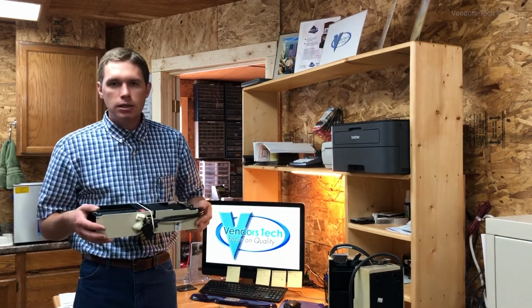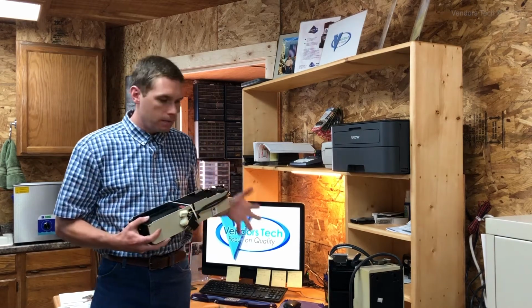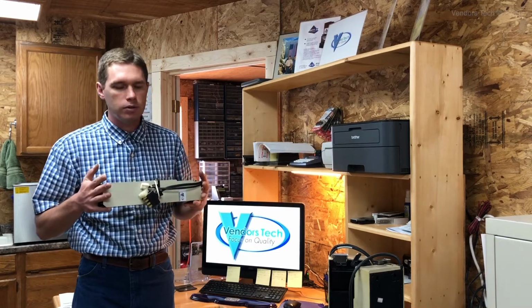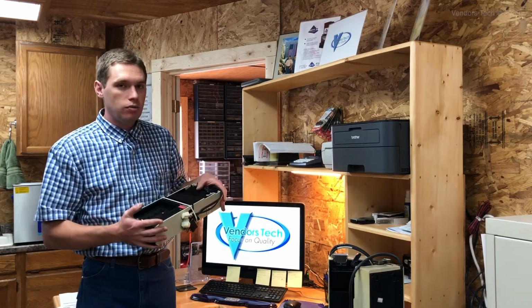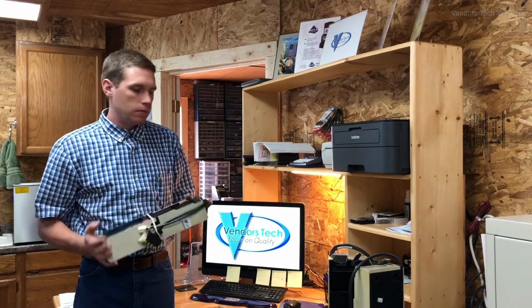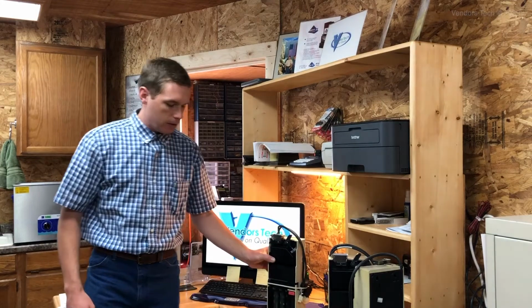When we package these, we're very careful. You've got to have padding here and padding here, because these things are incredibly fragile. All coin mechs are incredibly fragile. You've got magnetic wire and ceramic coils, and that ceramic just likes to crack and break like crazy when people slam the coin mech down on the table, or they move it around inside your truck or your vehicle.